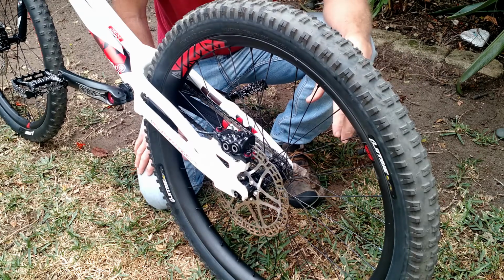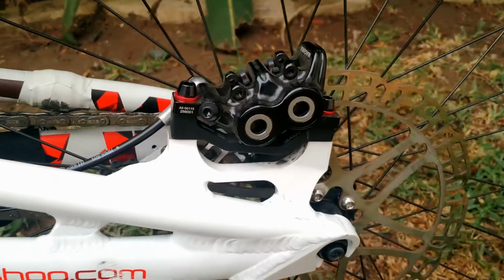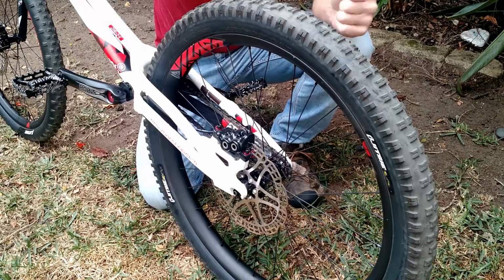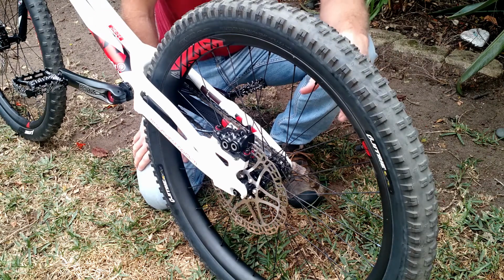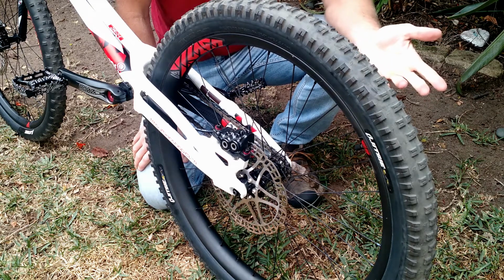Okay, so the rear end of the bike, this is the special end. This is what makes it different from a regular competition trials bike. You've got this beautiful disc brake adapter on there on a 26-inch bike. But this is also where most of the headaches came for me. I ordered this as just a frame, and it didn't really say in the description of the frame, it was all in French, but it didn't say in the description of the frame that the rear spacing was 116 millimeters.